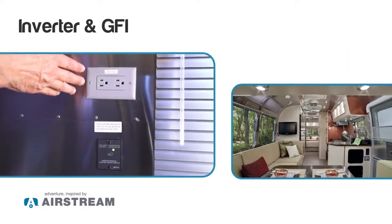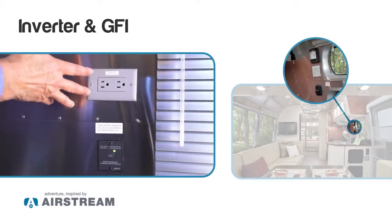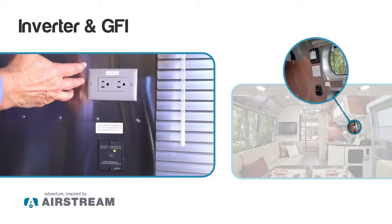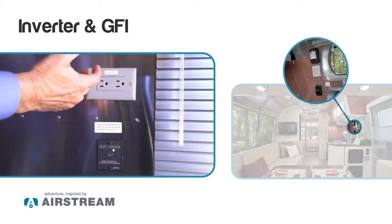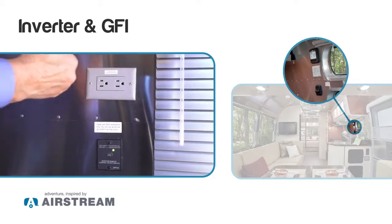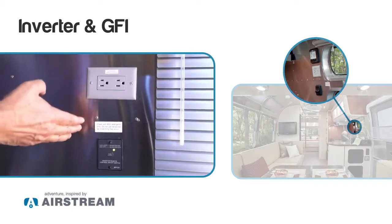Next, I want to quickly talk about the 110 outlet over the galley. The significance of this one is it's on a GFI circuit. So if you get a cord near some water, the GFI will keep you from getting shocked. So that could be tripped. The reset for that is in the bathroom.